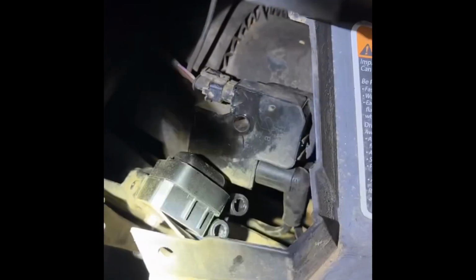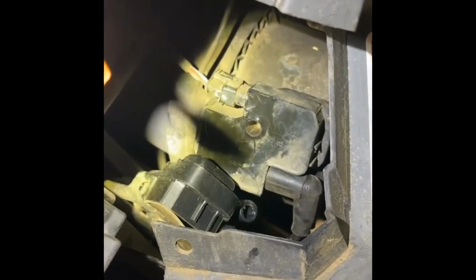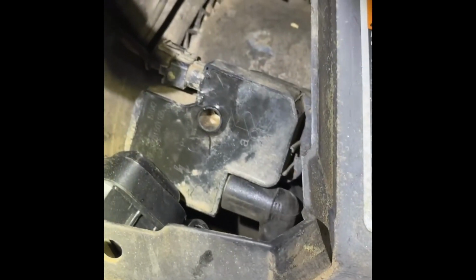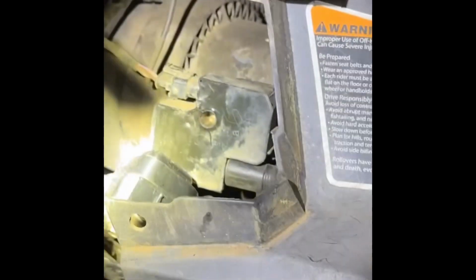Because I put the new coil on it and it wasn't skipping, but it was flashing the check engine light like it didn't like that coil or something. It ran, but it didn't like the idle. So I put my coil back on it. Perfect. I got new plugs on there and new plug wires, just the old coil, and it fixed it.